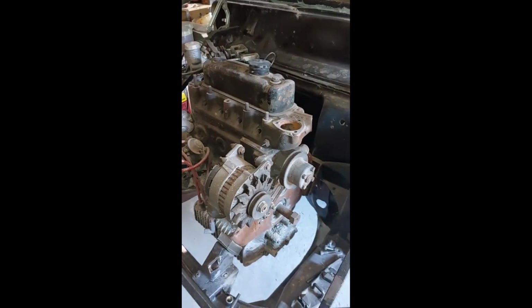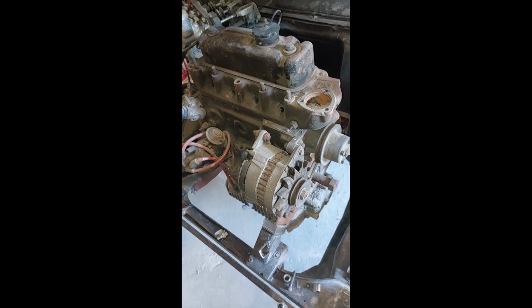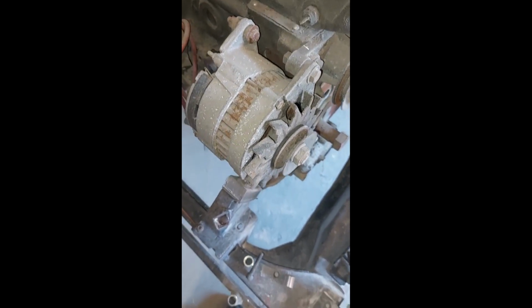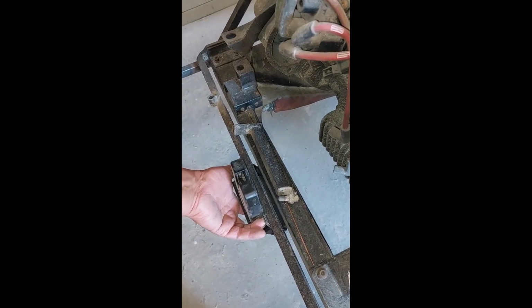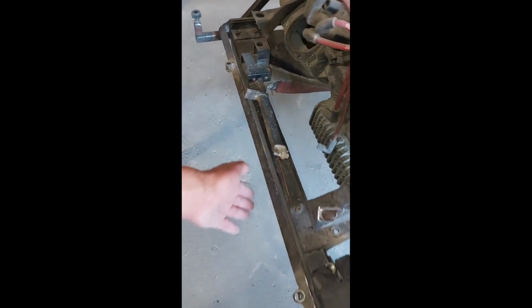But what I've gone for is this. It's a Ford Focus, I think, electrical boot release latch. And that actually mounts there nicely. Look how nice how it mounts. And the catch for it now mounts on that. So it's going to have an electric release for the bonnet. I'm going to bring some bracing across here, obviously. Once I've got this fitted on, I'm going to bring some in so it ties into these radiator mounts and finishes this off a bit better, a bit more strength.